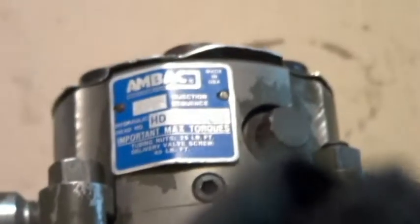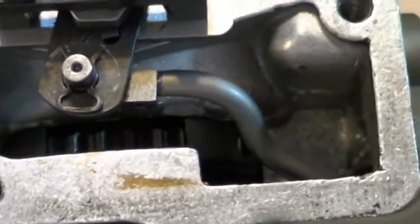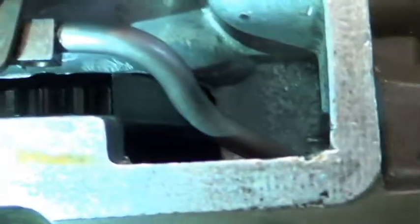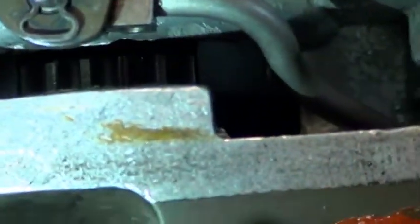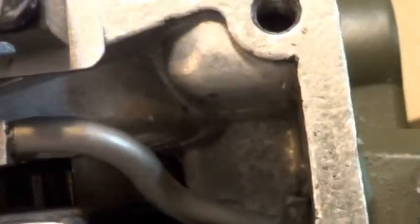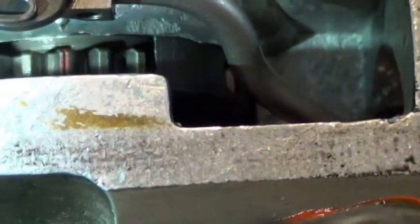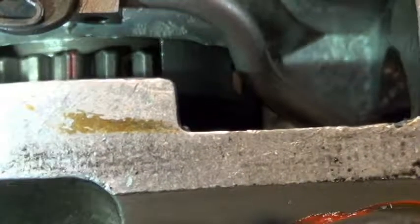I replaced the O-rings inside that you've seen me take out. Got the hydraulic head back on the pump, and back in here we've got the timing mark lined back up. Still got your little arrow and your pointer. It's just a titch off right now because I moved the pump. You'll see the mark on the arrow — right there, see that little arrow on the mark? So that's back together.